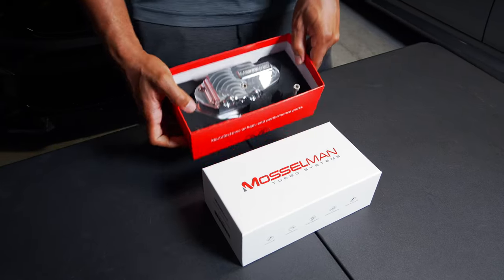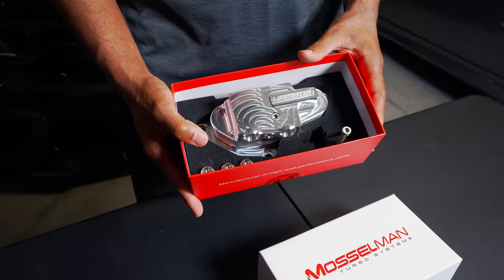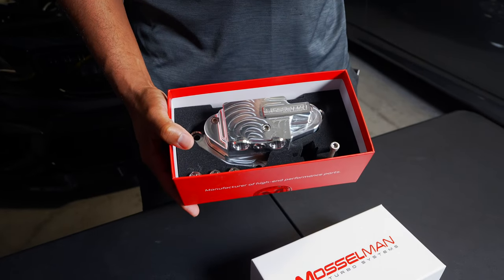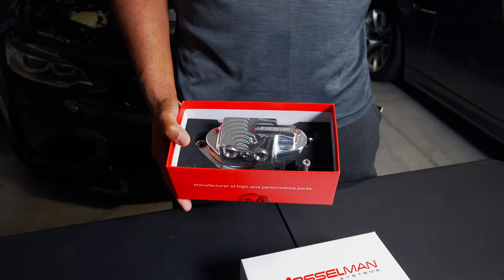What's really cool and unique about their new design is that it's going to open up much sooner than your standard oil thermostat. This one in particular opens up at about 85 degrees Celsius, and beyond that it's going to maintain the oil temperature at about 95 to 105 degrees Celsius, which is really good to maintain more stable power longer.